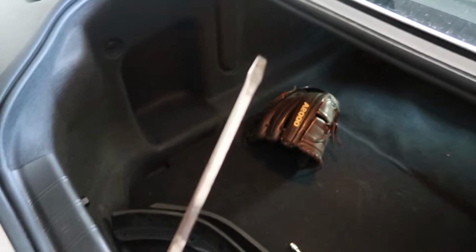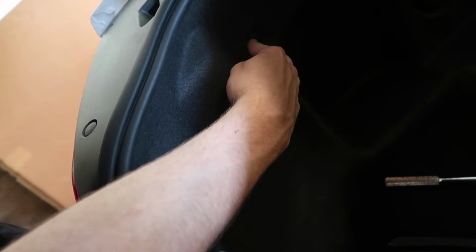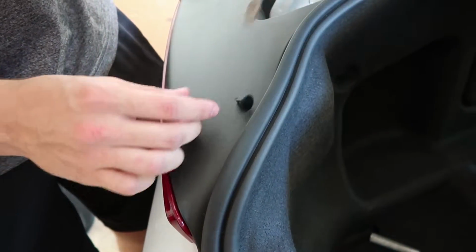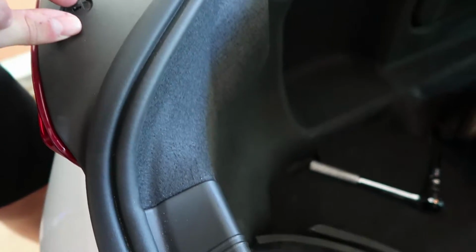All right. So yeah, you just need an 8mm socket and a ratchet. And a ratchet. And then there'll be 3 little bolts in here. And the flathead. You know, that's like a plastic fastener to pop those off. Yeah. And then the ratchet to take 3 bolts off. 3 bolts on in here. Do you have to take this stuff off? No, we just need to take this one clip off, and then we can pull this out. Pull it back here. Yeah. Okay. This is when I wish I didn't cheap out and I actually bought a tab remover. Oh, there we go. Does this need to come out too? Yeah, I think so.